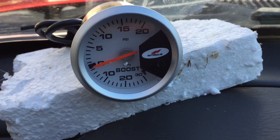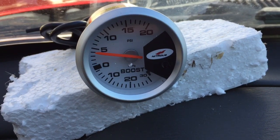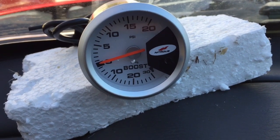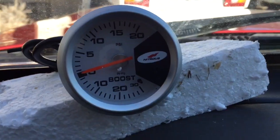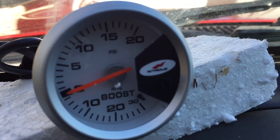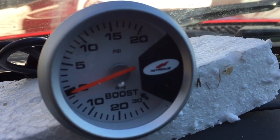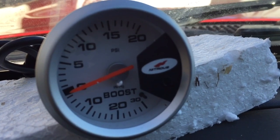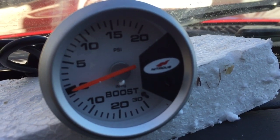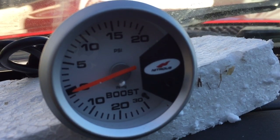So I'll start it up here. Okay, a little bit of boost. So that's just a little bit. Now shut this off and we'll see. It closes down and then opens up, or vacuum drops because the engine shut off again. So that's pretty much it. You get to see it working — that's about the only time we'll see vacuum on this gauge here.